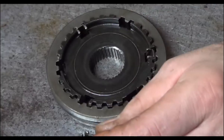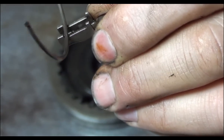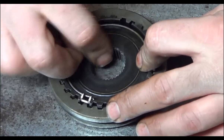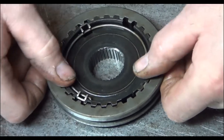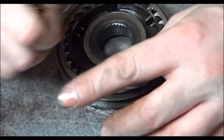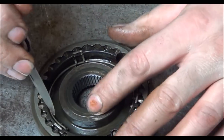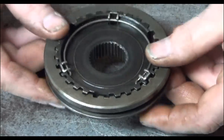The clip goes inside the slider. The slider is kind of U-shaped and you put the clip inside the U-shape. So put your dogs inside there and simply put the clip inside it. Then seat your slider into the dogs and turn it over nice and easy. Put the other clip in nice and easy. If you miss the U-shaped portion of the dog with the clip, just pry it in with a knife, and then you have an assembled slider and hub assembly.